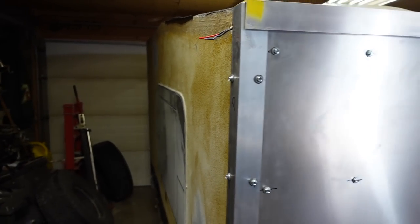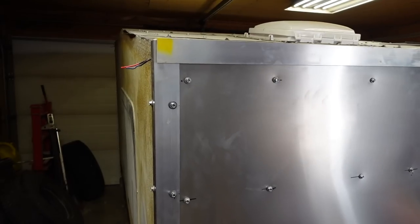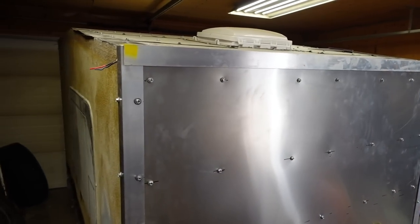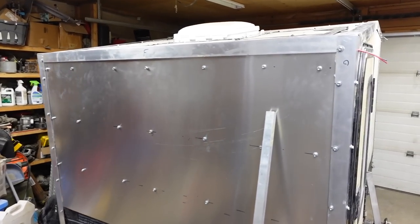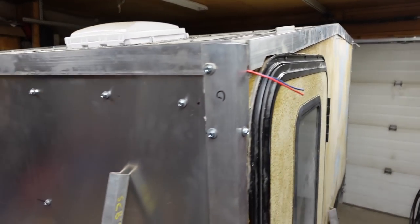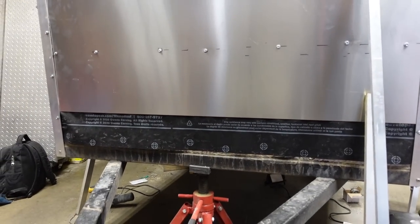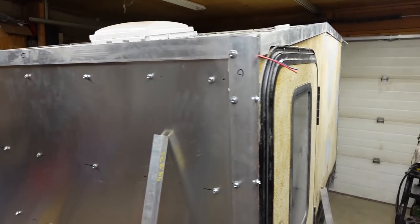I did the four corners and then I'm just gonna use that black silicone I used on the roof for the rest, because I don't want big gaps like that in the roof - it's gonna wreak havoc. So I'm just gonna start fitting up these end pieces and get those on. I just got everything fit up, I gotta get all the holes drilled to put those in place, but you can see now what I mean by boxing in the frame. Once I put the checker plate on the bottom section there, I'll be fully protected and looking pretty good.